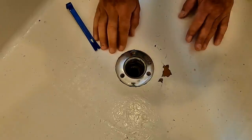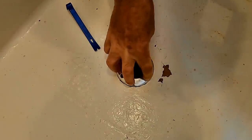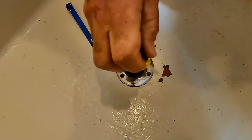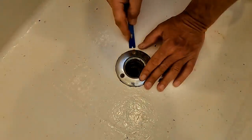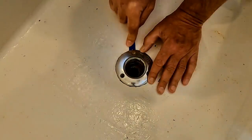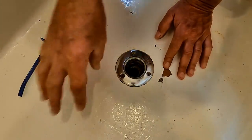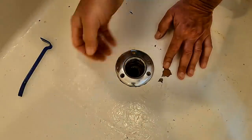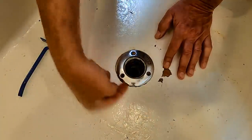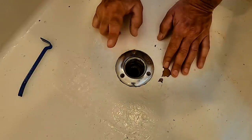A deck fill does have screw fittings to be screwed down to the deck, but there are no screws in these. I've poked around with various screws and I'm just getting right down to the plywood — whatever goop is holding the thing down. I think all I really have is it bonded down. I don't want to damage this any more than necessary; this is plywood that's been fiberglassed and painted. So I'm going to take a knife and run it around in here and apply some heat to try and soften whatever this is bedded in — most likely 5200.